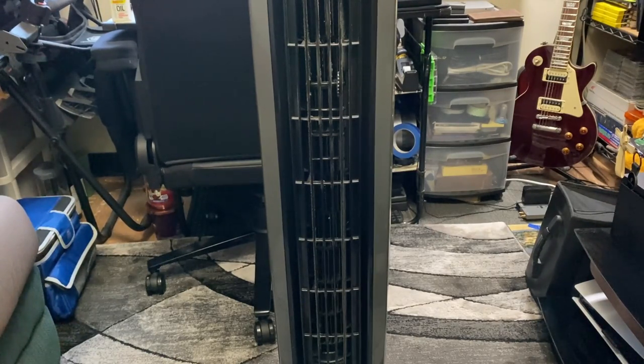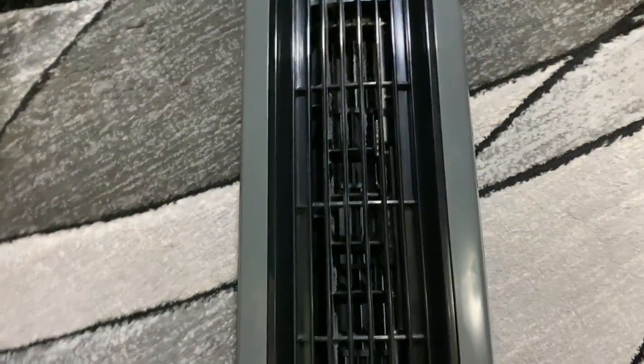It's a little bit easier and pretty simple. It's going to involve an air compressor and then just oiling it. I did use a drill to get to the oiling points I made for the motor — that one you can access through the fan grill — but for up top, I drilled a hole in the back to make it a little bit easier, though that's not exactly necessary.